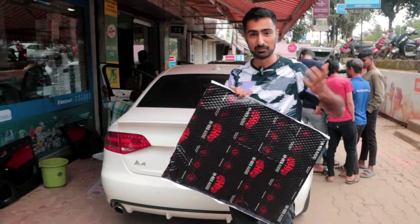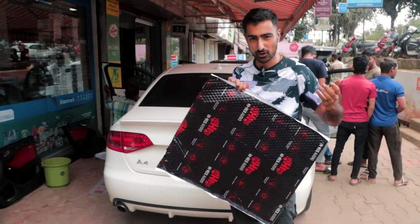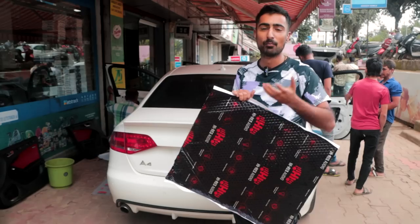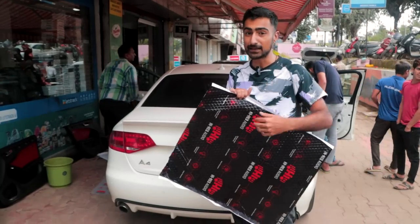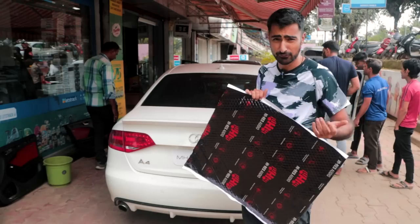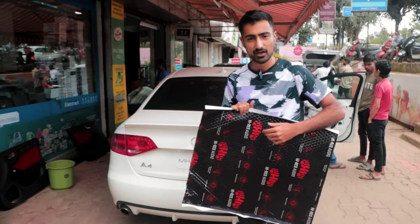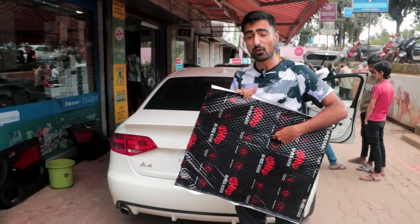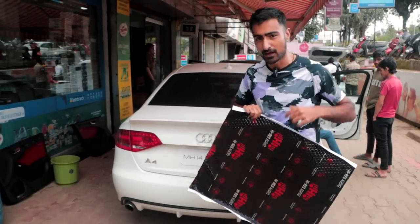This can be used in any car, but higher-caliber cars like an Audi A4 or luxury cars have very small gaps inside the door panels. If you have a more affordable car, those panel gaps are much larger, so you might need much more of this material. We're going to use maybe four or five sheets on all four doors, but if you have big gaps you might need ten to twelve sheets. It will make a world of difference, so definitely consider sound damping when upgrading your audio.